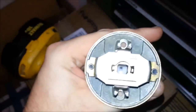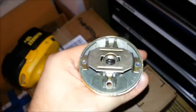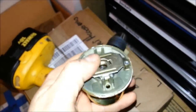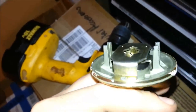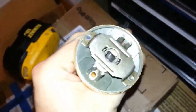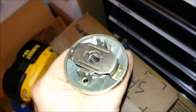So I'm thinking to myself, it's Christmas Eve, I'm not going to be able to fix anything or get new knobs for a while. What can I do? I'm staring at this, looking at this little bridge piece. It doesn't seem to perform any function other than engage those little locking dogs. So I'm going to take my drill and drill out these two beautifully installed rivets, which seem to hold everything together these days. Remove that thing and see if that doesn't solve our problem. Stay tuned.